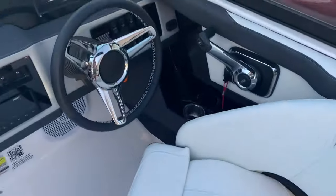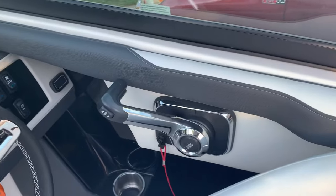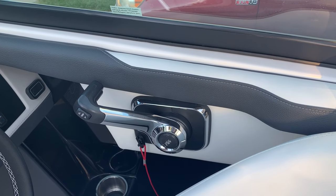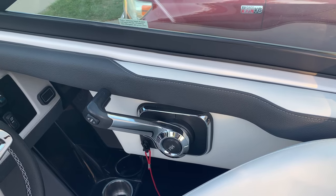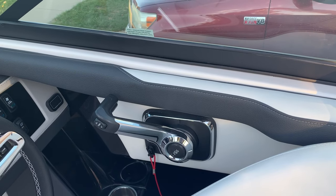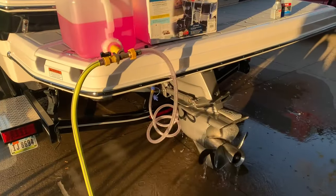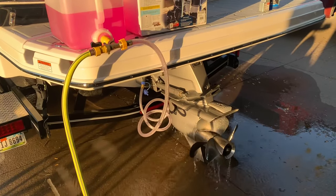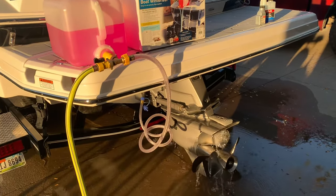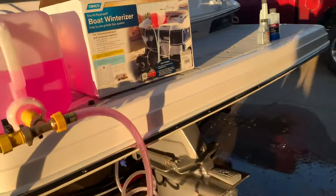According to the manual you're running at about 1500 RPM — I've got my tach set at 1500. To fast idle, you press the button in the middle while engaging the shifter so the prop isn't spinning. I'll let it run for about five to ten minutes, then idle back down and turn on the antifreeze. The antifreeze flush and the fuel flush have to be done at the same time — at the end of the cycle — otherwise one defeats the purpose of the other. The boat's been running about ten minutes, about half the gallon is already gone, so I'm switching on the antifreeze and my daughter will shut it off when the tank empties.